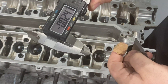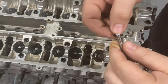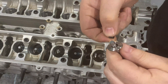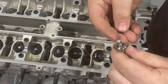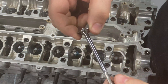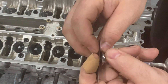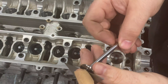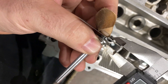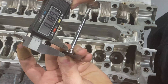Now we're on to measuring. Take your valve, take your retainer, stick it on there, put the locks in the right direction. Pull up on it, make sure it spins — we're good to go. Take your razor blade, stick it on top of the retainer. Now we're going to measure from underneath the retainer to the top of the valve, because that is where your spring is going to sit.